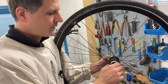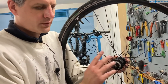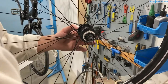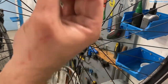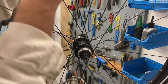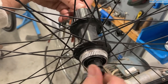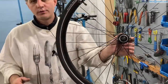Now I don't need to keep the cone super tight — just to make sure it's there. I will need to set the bearing preload. First thing is I need to put this spacer, and now for the lock nut. Before placing the lock nut I will put some anti-seize on the lock nut face that goes against the spacer and on the threads, to make it easier later on to remove. It's assembled now — all we need to do is set the preload and then lock it in place.